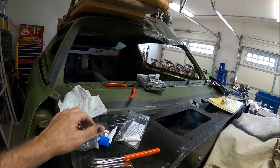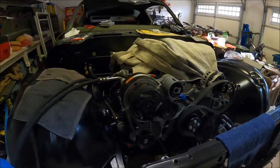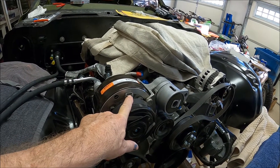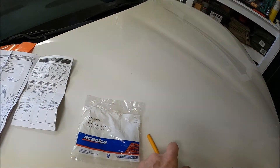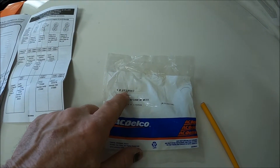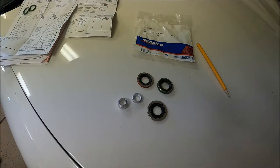I had a bag of parts — washers, collars, and O-rings in a separate bag. I ended up figuring it out, but I went back and tried to find my clutch pigtail. I couldn't find the pigtail, but I did find another seal washer kit. This adapts R4 compressors to different types of hose blocks. The part number is 2724887, and it came with three different rubber washers and two collars.